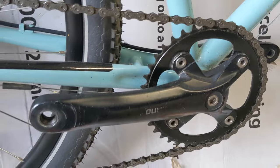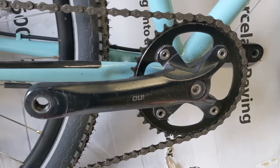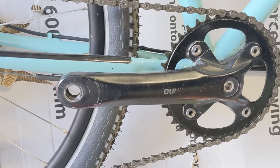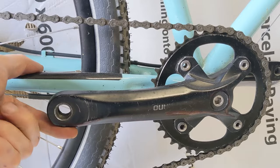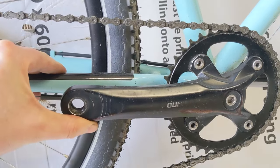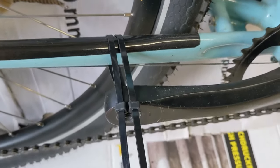Let's come back down to the cranks. I normally position the cranks so that on the drive side, looking inwards at the bike, we are at about nine o'clock — in other words the crank arm end where the pedal was is lined up nicely with the chainstay. The rear derailleur I always unscrew and strap to the chainstay because it's by far the most vulnerable moving part on the bike.